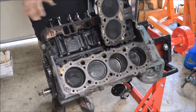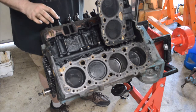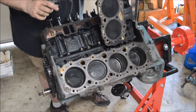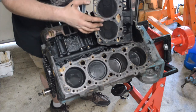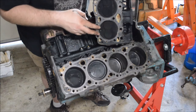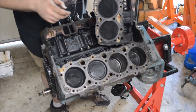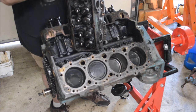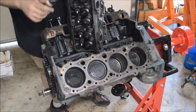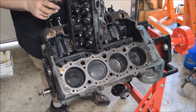I've spun the engine over. I've got the cylinder head bolted down on one side and I've only got two of the pushrods in place, but it'll allow you to see how the actual camshaft actuates the valves. This is the other cylinder head and this is the face that would be against the pistons in the combustion chamber — you can see there are two different valves. Typically the intake valve is a little larger than the exhaust. They're held in place with springs to make sure they return to the closed position, and then the rocker arm sits here, and as the pushrod pushes up it's pushing the valve in.